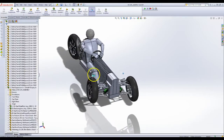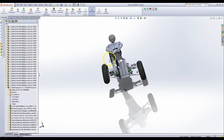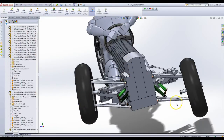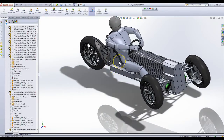Other than that, that's where I'm at right now. Quite a bit of work yesterday to get it to this point. Going forward, I just have to work on some of the clearances. I'm going to go through my design library books on suspension design and steering design to figure out the optimal placement of the steering rack to prevent bump steer. I did run this suspension geometry through an online suspension geometry solver and it gave me a shorter length for the upper A-arm, which gives me two degrees of static camber and the best characteristics in bump and tilt. It looks pretty good except for the steering.